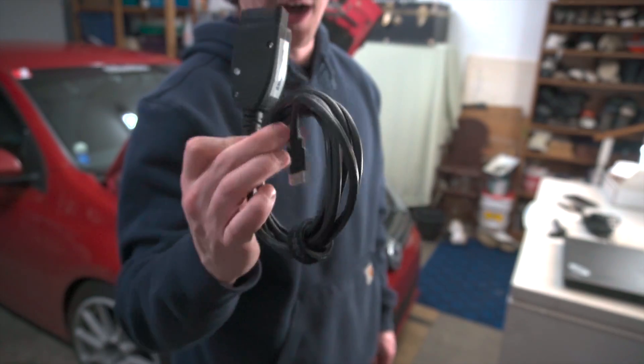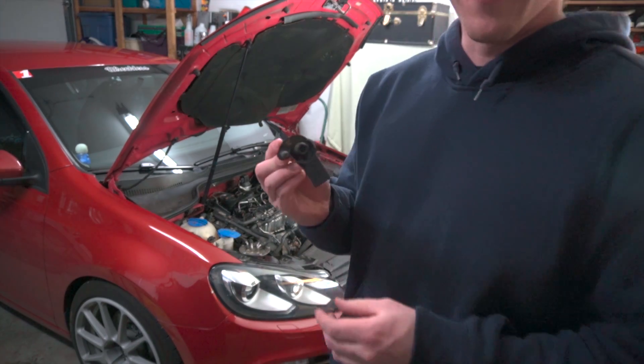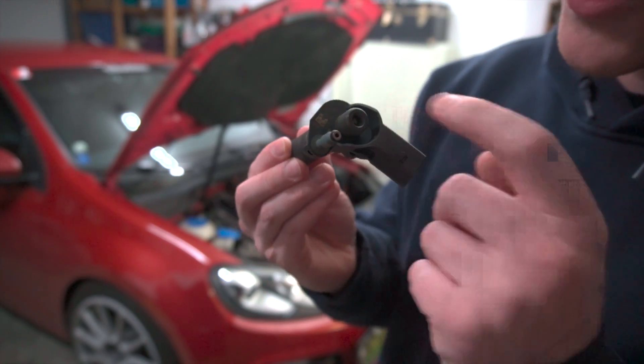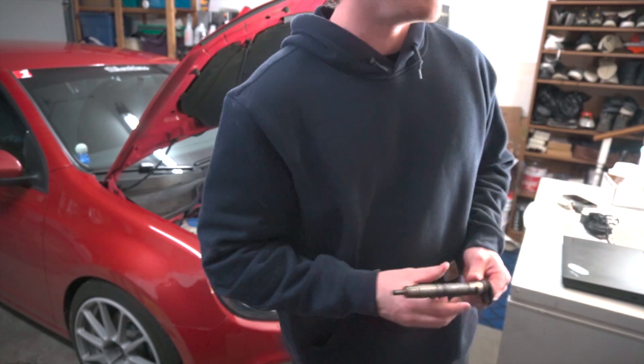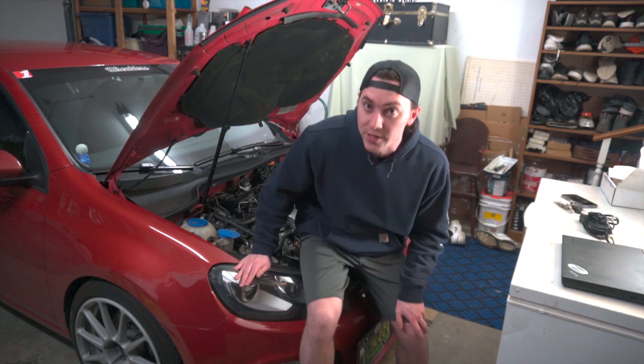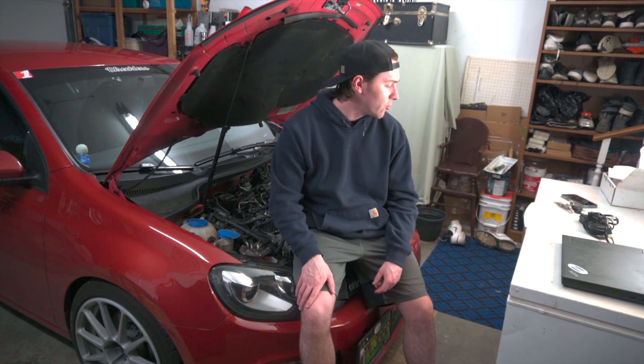This is VCDS — this is an older cable. You're gonna need this because there is a very important part number on the top of these injectors, and you're gonna need to code all of those individual numbers into your ECU software in order to get your injectors to run properly. You're also gonna need to do some tuning. I am tuned by Malone, or Tunezilla — whichever you want to call it — and I have a tune waiting to throw on this car. We're going to go from A to B on this entire process.